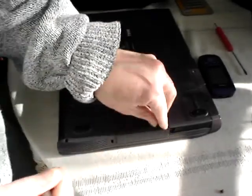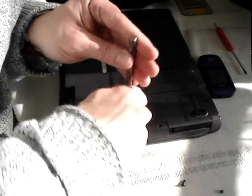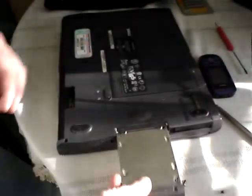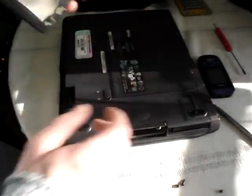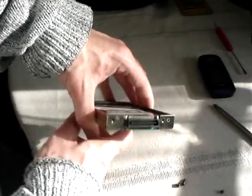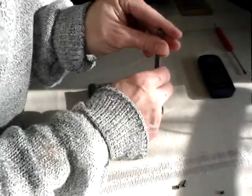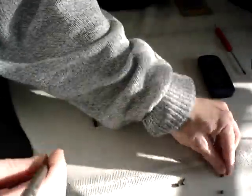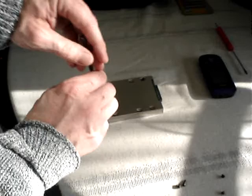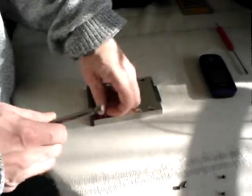So first of all, undo this screw and then the other one, and then it clips out like that. I've removed two screws. It depends which version of Latitude you're running — similar to the A-Series, because some of the cradles don't have screws on them, but the hard drives click into place. So this is not a hard task, it's a nice easy task — it's just the amount of screws that need to be done up.